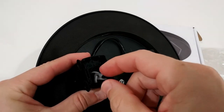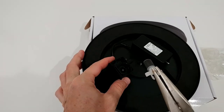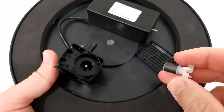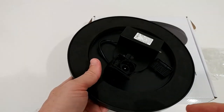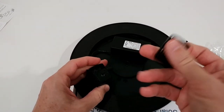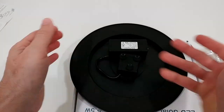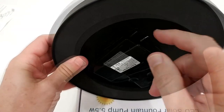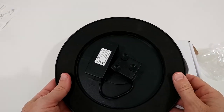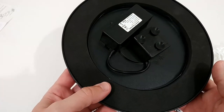When the whole thing is open you can go further and remove the protection, and even take out the impeller. You'll probably need small pliers to do that. There are no wires or connections — it's just a magnetic attachment, so you can clean everything easily. Every now and then, check if you can remove it, clean out all the dirt, and put it back. There also appears to be a sensor: when we touch the unit it starts to spin, meaning if there's no water it will stop and not damage the pump.